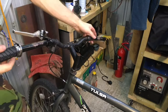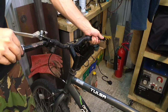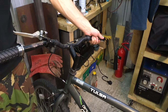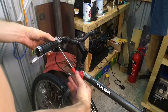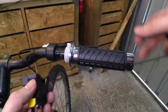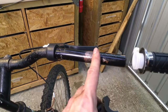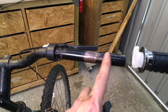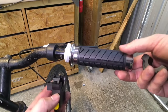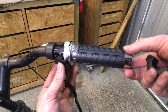We'll put the clutch on first. For the grips, a good way of getting these on is to put a little bit of diluted washing-up liquid on there, because the washing-up liquid will evaporate after a while. Fitting the throttle and kill switch: you want to make sure this is all nice and smooth - put some grease in there, preferably white lithium, which is okay for plastic, and then it will rotate nicely.